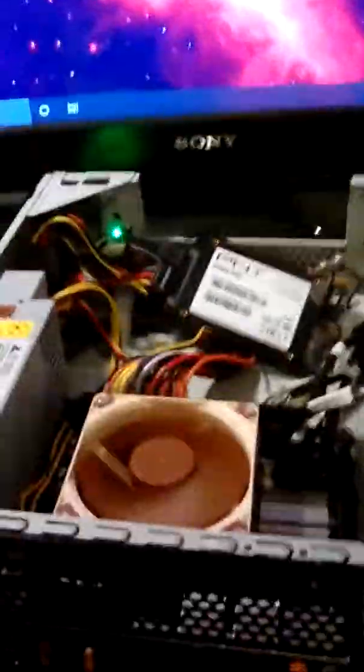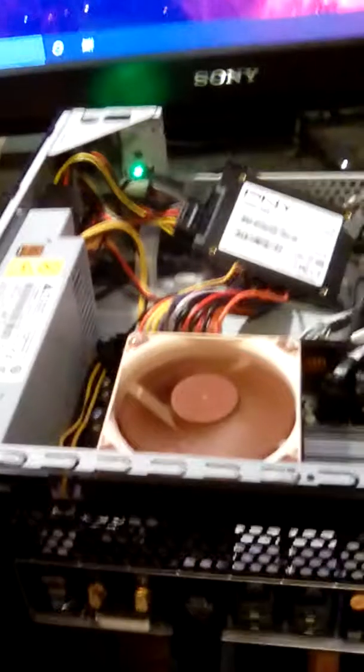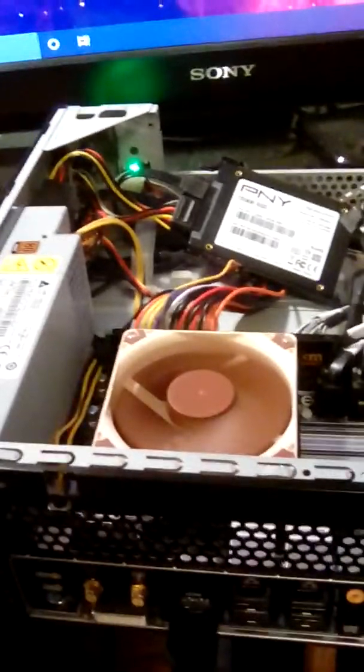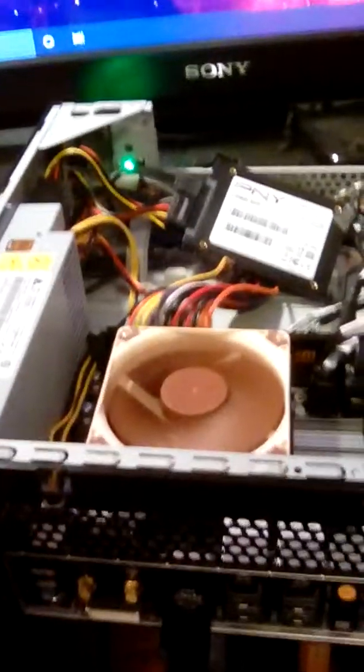It gives me that error because I don't have both hard drives plugged in — I have my user files on Drive D, but I took out the drive rack to make room to put the RAM in and out. So one DIMM that doesn't work again. I really hope I don't have to wait another month, but that's it.